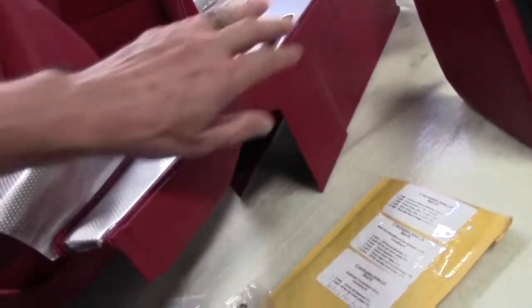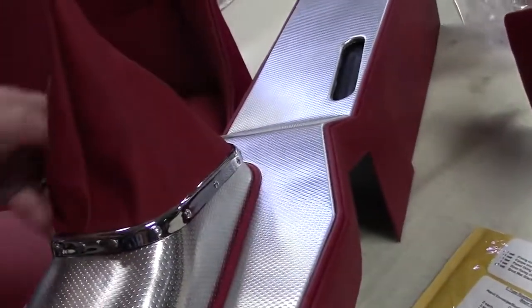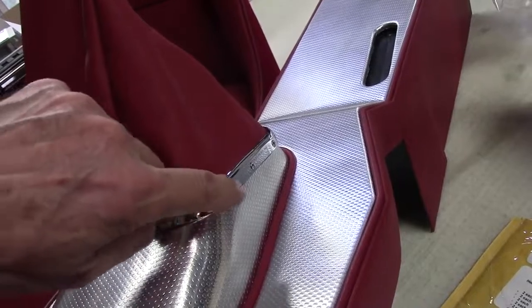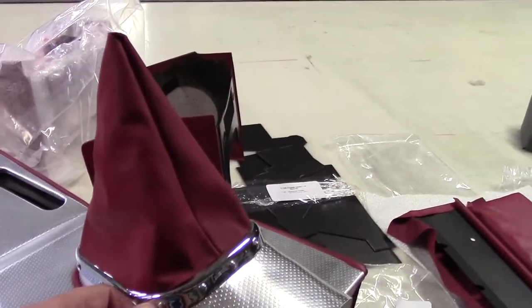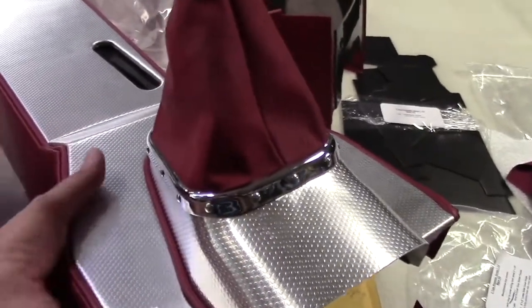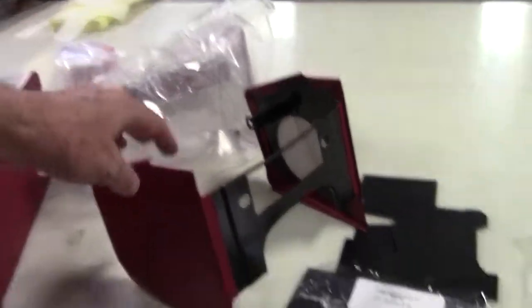This is the reproduction console — the originals of course had flatter sides. We put a new rubber in for the handbrake and the leather shift boot. Another extra is the shifter chrome — strongly recommended. It's very difficult, in fact impossible, to get the original off without the drill walking off these dome-shaped screws. If you've ever tried to take your originals apart you'll end up messing up your original because it's extremely difficult — you have to center-punch each one, and even then they rarely come off without damage. Recommend the new one. Polka dot panels and aluminum panels are available from us periodically — supply on that is pretty sketchy, but try us. Also the radio fascia panel with the leather for the ashtray.